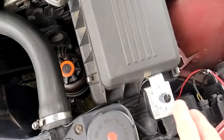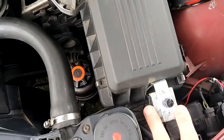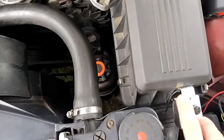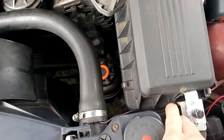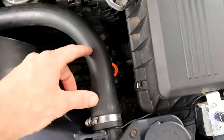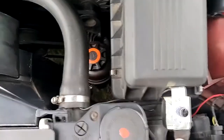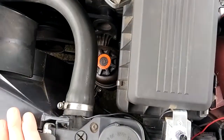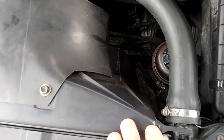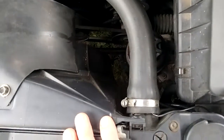What it has is your power goes through to a relay, and that's for setting off the relay which activates the main power to the fan. How it gets a temperature reading of your water, or your antifreeze, is this wire here goes through and into the radiator hose, and in there is a long stainless steel prong. That was really easy to set up, and then once I put the fan in, I just simply wired up to the thickest wire - knowing that's the highest amperage wire, which means it's the high speed wire - and I ran that through to the relay.